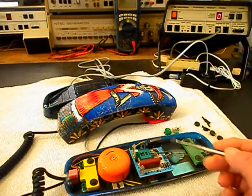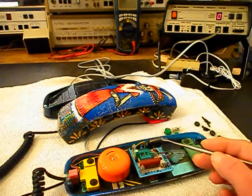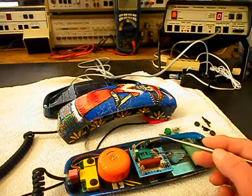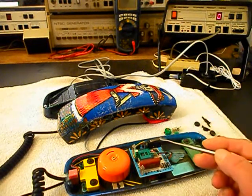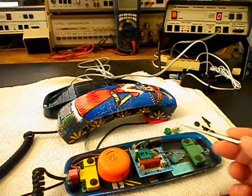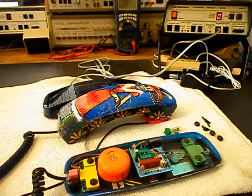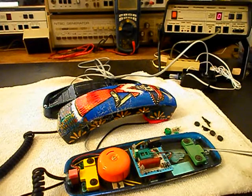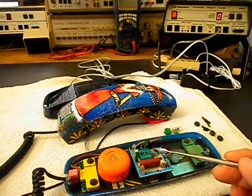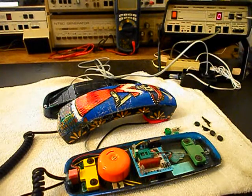We want to hold the hook switch down. In this case, the setup is that the switch is actually in the up position when the telephone is hung up. When I push this down, you're going to hear dial tone. So now, we know that the telephone is hung up, and we want to ring the unit because it's going to ring once or twice, then the circuit here is going to saturate and take the phone off the hook for a second. It'll seize the analyzer over here for a second and stop the ring cycle.